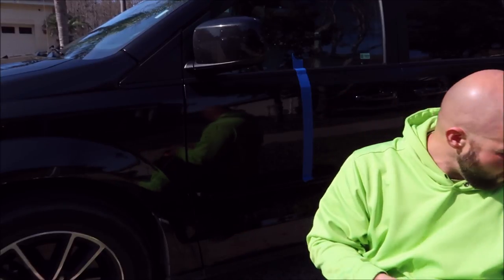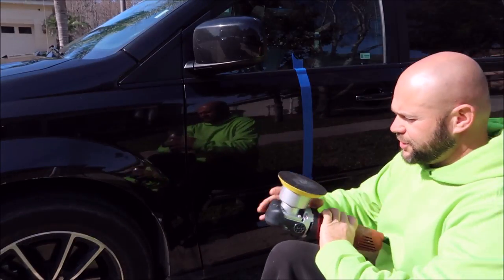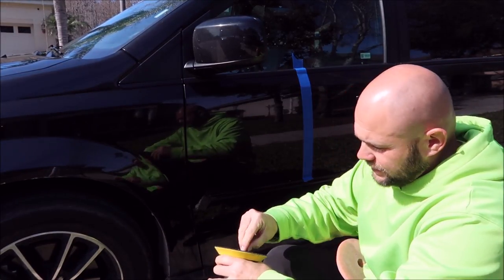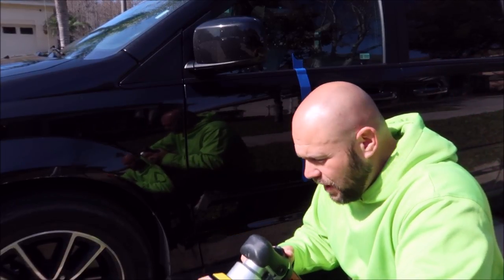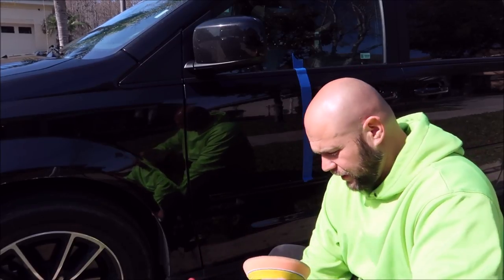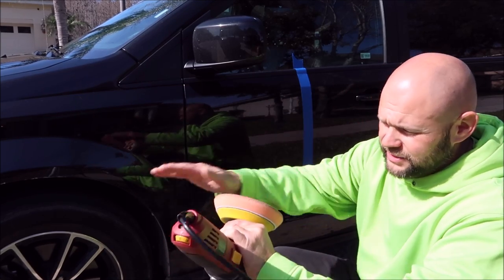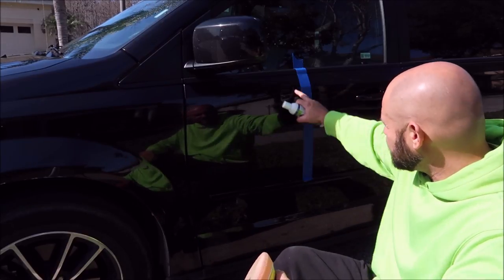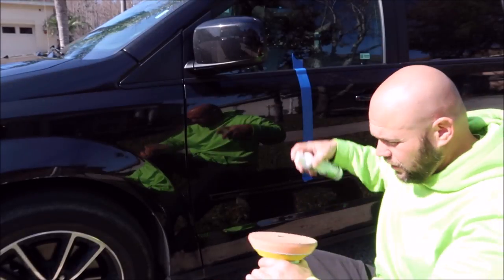Now what I'm going to do is hook up my trusty Harbor Freight DA. I've got my 5-inch Buff and Shine backing plate on here that I sell at DetailJuice.com, and I'm going to put an orange Buff and Shine Eurofoam polishing pad on here. It's clean, I've just used it before. I washed it and let it dry. I have an LED light we're going to inspect with, but I'm going to polish just this section right here. Then we're going to pull this tape off and I'm going to show you with the light the difference between the two. So, without further ado,